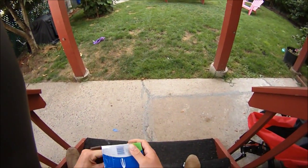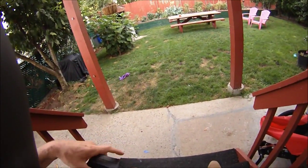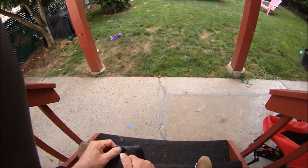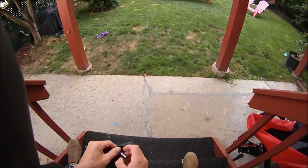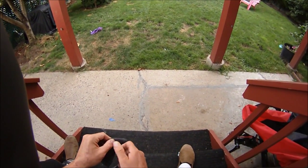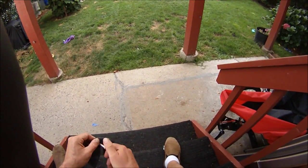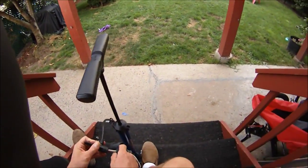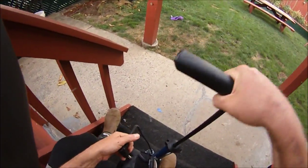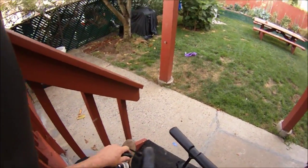Got to take out the tube and partially inflate it so it gets its shape and is easier to work with. Very important step. There that goes. Alright. Take this off. This little ring helps secure the Schrader valve once it comes through the hole of the wheel or the rim. Alright, and that is off now. Pump it up a little bit. Beautiful. Okay.